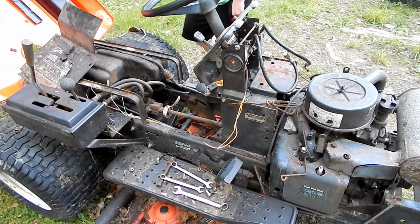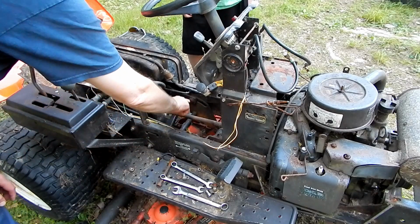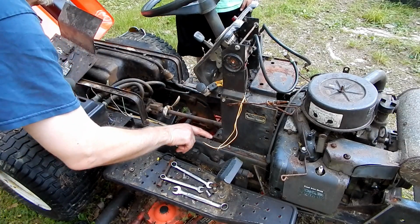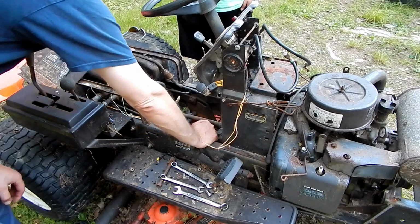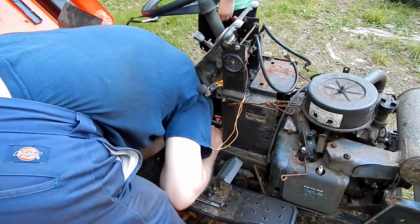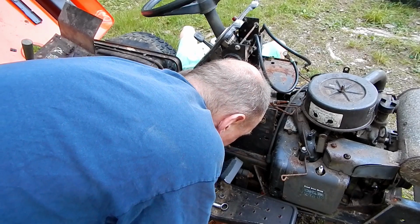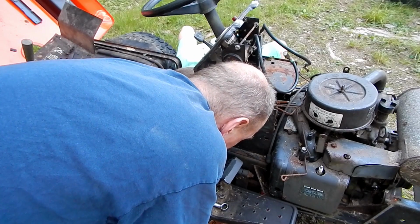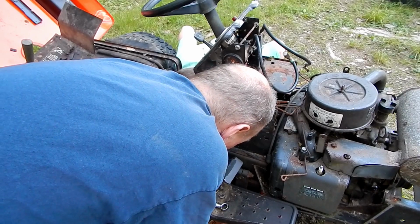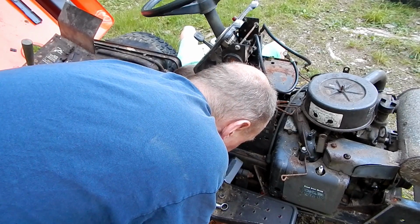Well, Mark, while I work on trying to get that spring off to get the belts off. No, you see this shaft? This drive shaft goes to a coupling up there that's bolted to the motor. So you have to get these two nuts off that are way in there. See this piece I got my fingers on? See how there's a couple of nuts? See how there's 4? You don't have to take all 4 off. You only have to remove the 2.